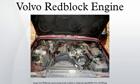The B21 featured an 80 mm stroke and 92 mm bore. In the US, the B21's power output ranged anywhere between 98 hp and 107 hp, based on variations in the compression ratio and was typically supplied with a B or M camshaft. The engines are tilted approximately 15 degrees to the left to make room for the more complicated injection systems. B19 and B21 blocks can be identified by water plugs on one side of the block, while B23 blocks have them on both sides.